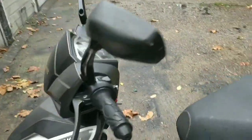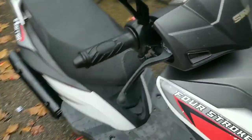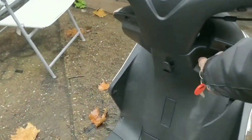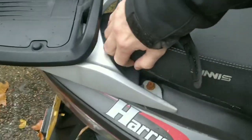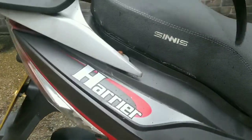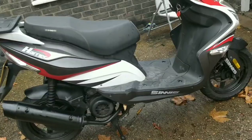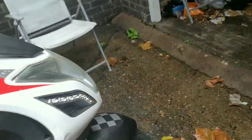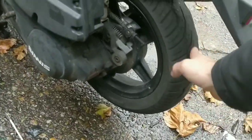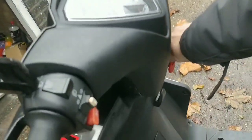Check your brakes - make sure the brake lever doesn't touch the handlebar, that's the first check they do. Pull it back, it shouldn't touch the handlebar. That's a drum on this one, this side's more important - pull it back, it shouldn't touch the handlebar. Check all of the high beams and stuff. The seat has to lock guys - if your seat isn't locked because somebody's popped it at some point, get a bungee cord and strap it down for its MOT, that is legally possible. And the last thing is make sure you've got air in your tires - I think my rear tire is a little low, it might even have a slow puncture, I'm going to have to look into that.